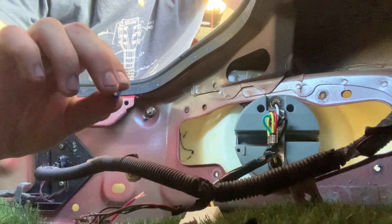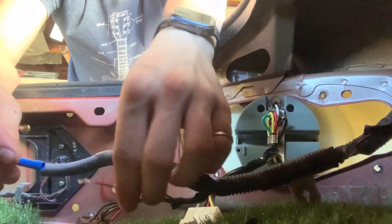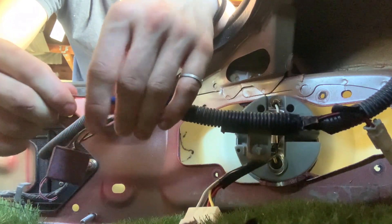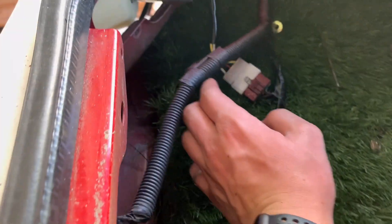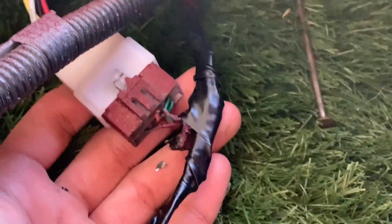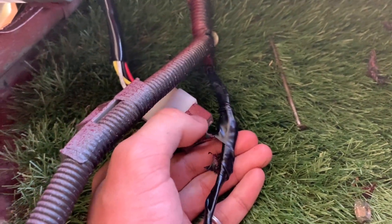Now I know where the positive goes. This right here is called a crimp connector. What a crimp connector is: it's a little metal tube — you put a wire on both ends of it, take a pair of pliers, squeeze it down and crimp it, and it bends the metal around the wire to keep the wires connected. The best way to use it: slip it over the wire, take the two wires, open them up, twist them together, then push the crimp connector over them and squeeze with pliers. My wiring skills are terrible and that was only my second time ever wiring — but I then came back and used electrical tape to wrap it all up. I took the wire, plugged it into each pin until I found the one that made the light come on, cut it, used a crimp connector, crimped it, heat shrunk it, then wrapped it in electrical tape.